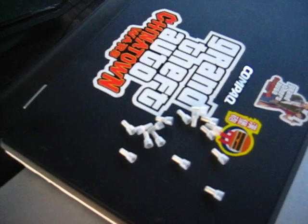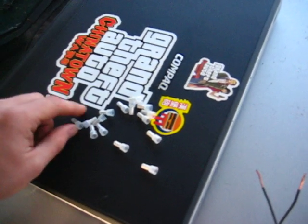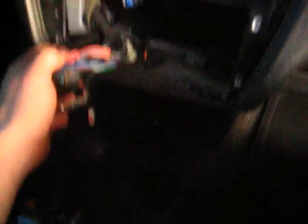So here's how you convert it. First of all, you need these types of tools: wire caps, or however you decide to put the wires together. I don't recommend doing it with electrical tape because it does get hot behind the dash. I usually solder and shrink tube everything, but I don't know how the engine job is going to come out so I might as well just do it as fast as I can. You need the crimping tool, wire strippers, and also some electrical tape to neaten the wires up in the dash. With your paper, you go in the car and cut these terminals off — cut them all off at the base because you're never going to use them again. Then strip all the wires, line them up with your paper, and crimp them on.